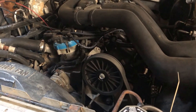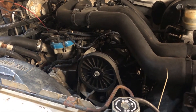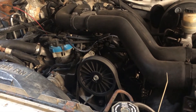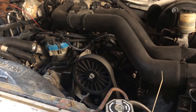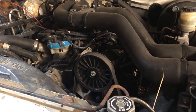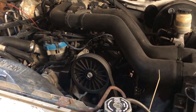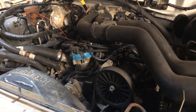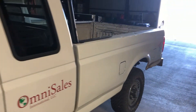I do intend to fix the air conditioner at some point, especially if I need to use it during the summer. Summers here are just brutal - we're in the armpit of the south. I mean 100% humidity, 100 degree days, and I'm gonna need some air conditioning. But in the meantime, I've got an old compressor. The clutch assembly on it's good, it turns free and everything. So I'm just gonna stick that on there and eliminate this crap altogether.